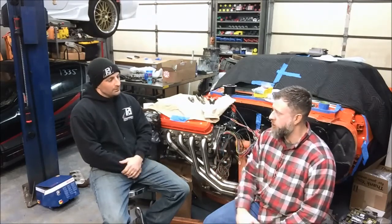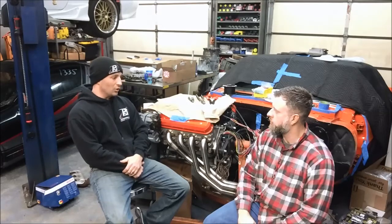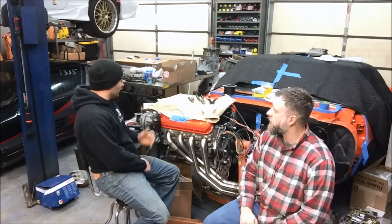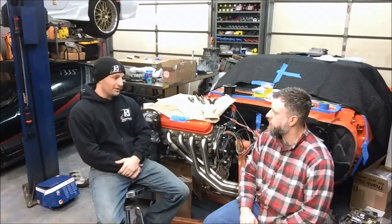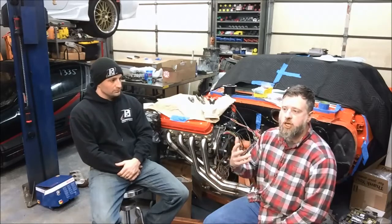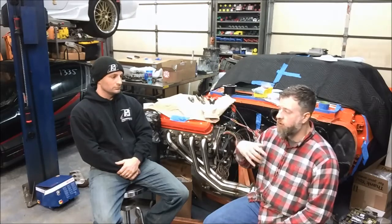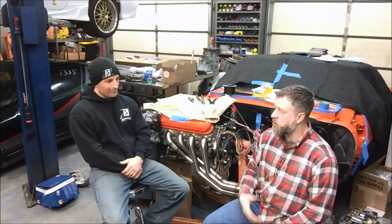Some other differences between Gen 3 motors are the alternators. You have a truck alternator, a Camaro alternator, and a Corvette alternator — there's actually a Corvette Gen 3 alternator right here. It'll look similar to a Gen 4 alternator, but it'll have the 4-pin flat connector on it. Some of the trucks had a 2-pin connector alternator, and the GTO also had a 2-pin alternator connector. LOJ sells an accessory drive package to keep your factory Nissan alternator on the car for 300ZX, 350Z, and G35 swap kits, so that wiring is generally removed from the harness before it's sent to a customer. But if you want to run GM accessories, just let us know when you place your order and we'll make sure the correct alternator connector is there for you.